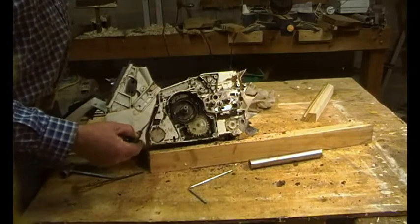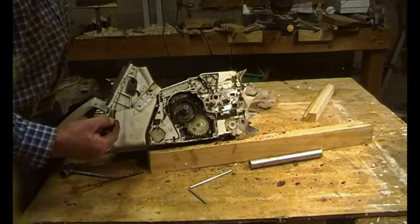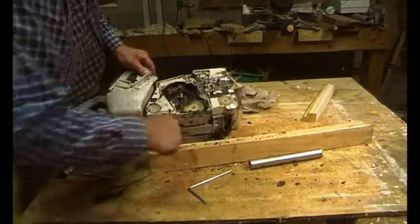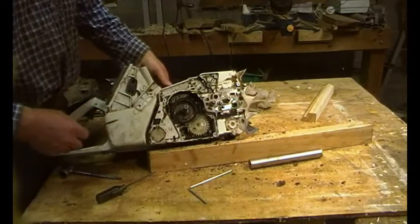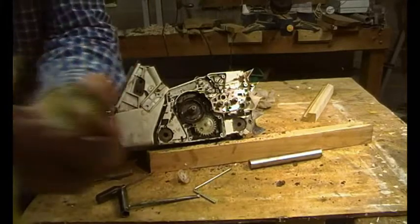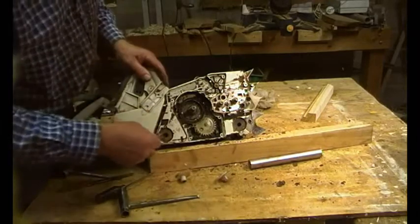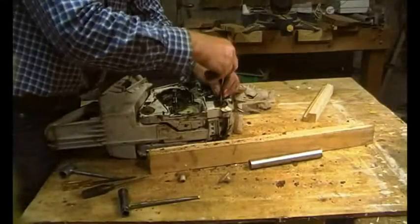We can remove the subframe. We need to remove the crankcase from the subframe - the carburetor can stay in place. So we have to hook out things like this gently. There's a rubber mount round the back here. They pop into this rubber so you've got to lever them out. Let's undo these mounting screws - that's loose, but this one is a bit rusty.